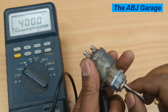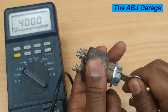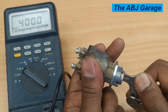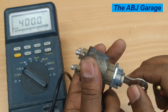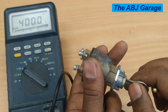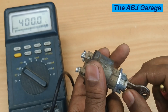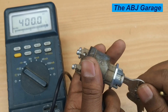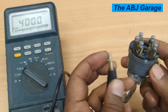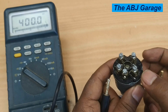The next position is the spring-loaded start position. Some ignition keys require pushing it down a little in order to put it on start — push it down, then put it on crank. This is to prevent accidentally putting the ignition switch on start while the engine is running, which would cause the pinion to engage the flywheel and damage the starter motor. On some ignition switches, you should push it down and then turn it clockwise to give power to the starter motor.